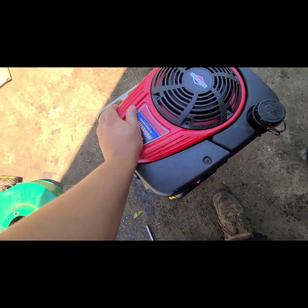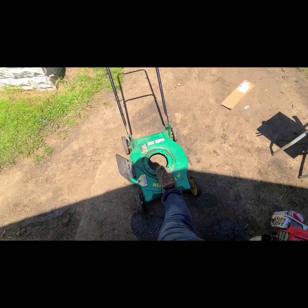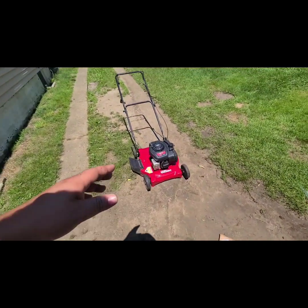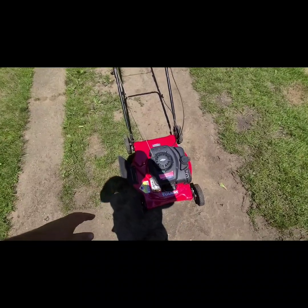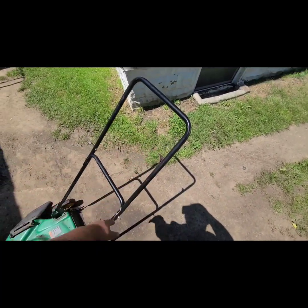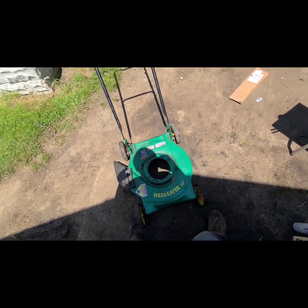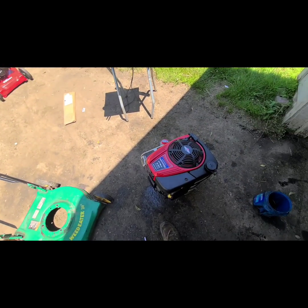Welcome to Zenz Mowers. On today's video we are putting this eight and a half horse Briggs engine on this weed eater side discharge deck. This is a 20 inch platform. I was supposed to put this engine on this deck back here, but there were a change of plans because this little three horse Briggs came on this weed eater deck. This weed eater deck used to have a Tecumseh motor, so I had a heck of a time finding a brake cable that would accommodate a Briggs engine for this deck. So we figured we'd just go ahead and put this power washer motor on here.